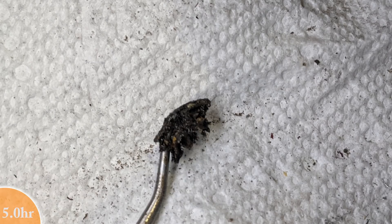A little trial and error there — I didn't damage anything. This is the bearing in the trunk area, and I can't even move it with my fingers. This one's the problem. It's sealed on one side, open on the other, and it's just got a lot of dust in it. This other one is kind of the same thing — a lot of dried grease, a little bit of dust — but it spins really nice.